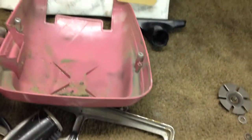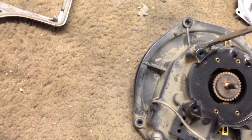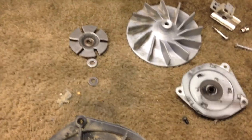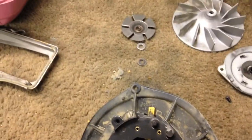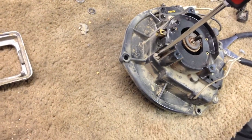Now, to seat the carbons and clean the armature, which I'll show later on in the day, we have a bearing that's been cut out to allow for a seating stone to touch the armature. I think it's in a box. It used to hang up, but I think it's in a box now. When the time comes, I'll show it. Sort of a handmade tool again. This is a two-handed job that I'm doing with one hand. So we pull this out.